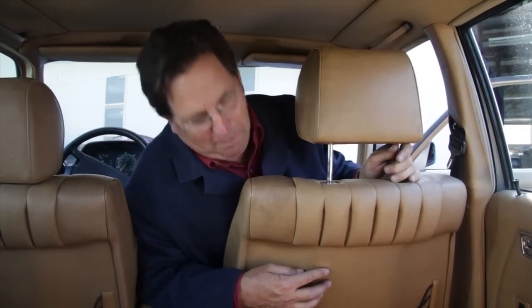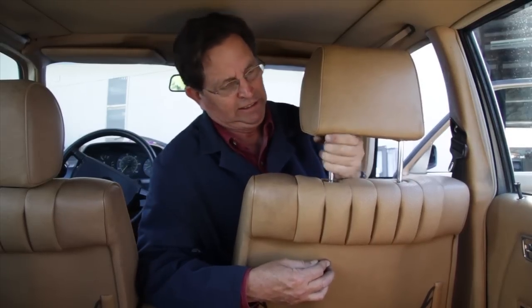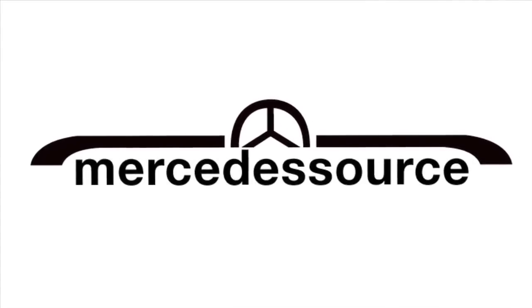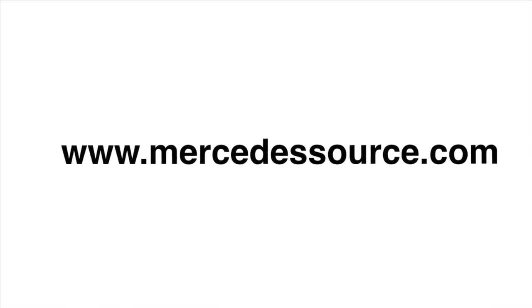Okay students, let's end with a quiz. Does anybody know how to remove a headrest? When we were filming, my poor cameraman didn't know how to get the headrest out — when you pull up on it, it just stops. Leave it to Mercedes to hide the fastener again. If you look closely there's a little button hidden right behind the rear upholstery panel. Push in on the button and you're able to get this silly thing out of here. Thanks for watching, and be sure to check out my website for new and used bulbs, wood pieces, and switches.